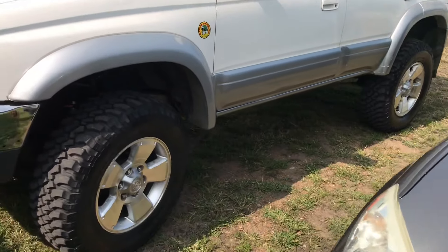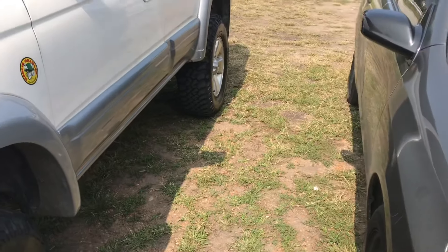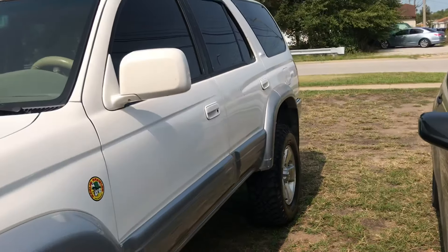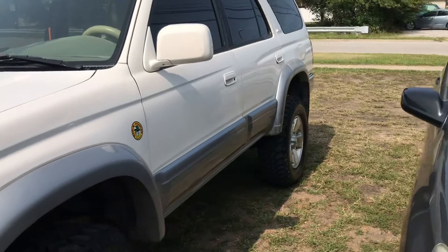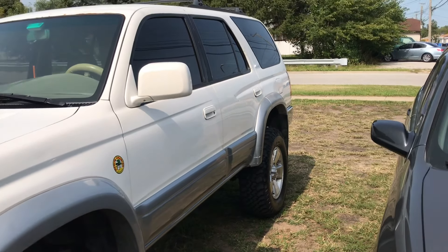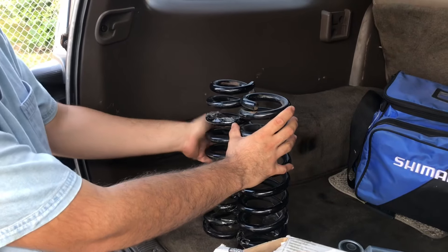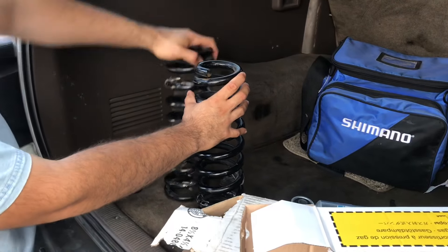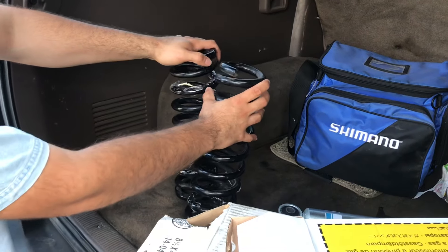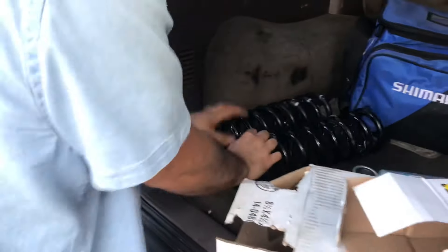I'm also thinking I might need some wider tires. The stability is still a little on the weird side — I feel like the truck's too tall now, so I need wider tires. There's also a driver's side lean caused by the fuel tank, so one coilover is a little taller and goes on the driver's side. That way it evens out the weight distribution, making it sit level.